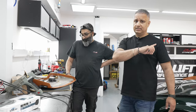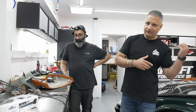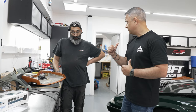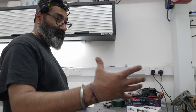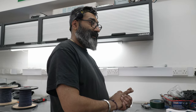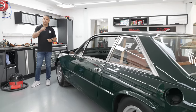The Bremen unit has actually already been fitted previously — he bought that from us a month or two ago. That's the SQR46 DAB, an old school retro unit. It's probably a little bit new for the Ferrari because that's a 70s car with an 80s unit, but that's the best you're going to get. There are another pair of speakers in the doors as well. In the front doors, these are the actual grills on the door cards. We've originally gone for a six-inch but may change the size to a five depending on what we can squeeze in. All in all, he'll have six speakers, a five-channel amp and a sub.